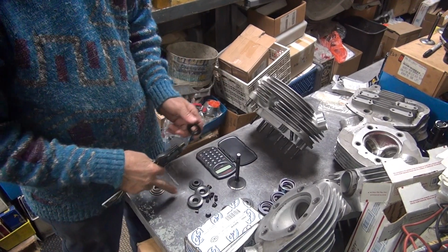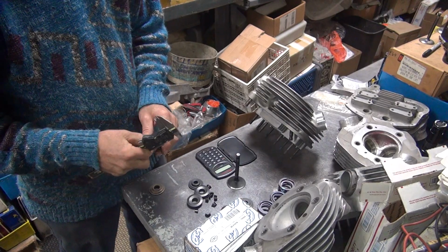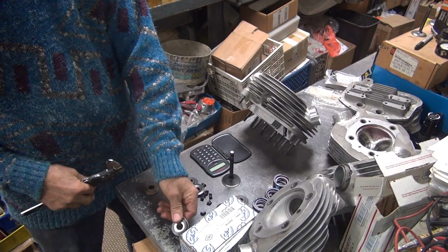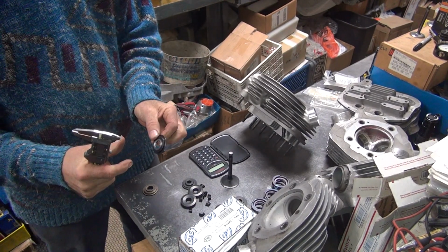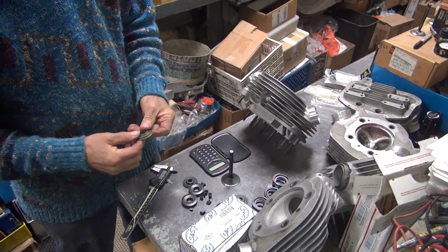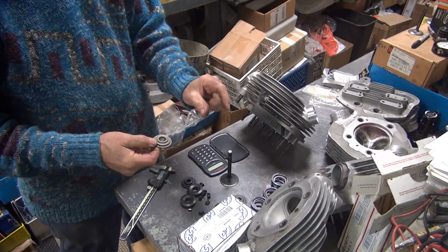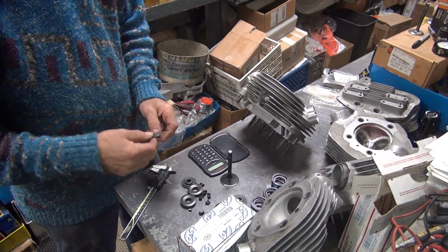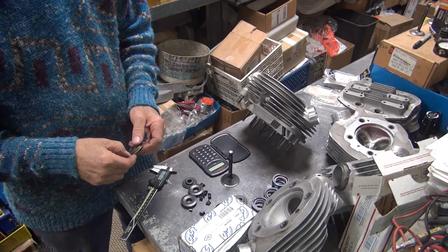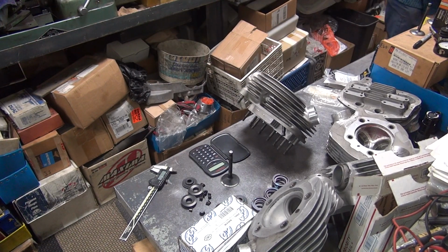So instead of being at 820, 830 like we're at now, normally we're out there 860, 880. That's what we gained. That collar is made differently than stock. So if I put these in a bike that has limited travel, it will give me what I need, instead of using a Harley one. So now I know those help me. Put that in the back of my head. So when I have a coil bind issue, I can just swap that collar in. Or I can go over there and grind the one that is plus 50, which does the same thing.